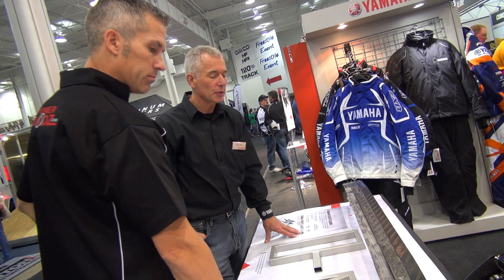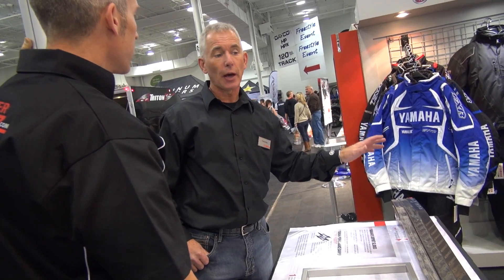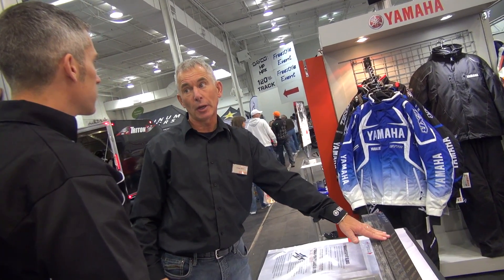At the end of the season I did a similar comparison and there was very little wear on the HiFax. It's a good solution for a lot of guys, and you'll be seeing it as a standard feature on Yamahas in the future. Some guys say they just put extra idler wheels on and that fixed their HiFax problems — but you probably lost somewhere in the neighborhood of 5 to 10 kilometers an hour of top speed, because you've added more resistance and friction. These actually increase top speed by almost the same amount, so there's a performance gain. When you have a performance gain, you also have a gain in fuel economy — you will get better fuel range and pick up a bit more top speed in any snow condition.